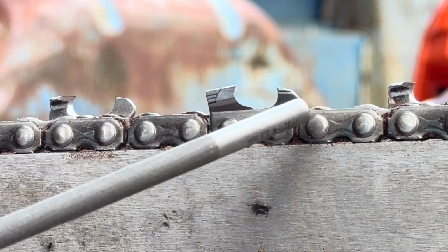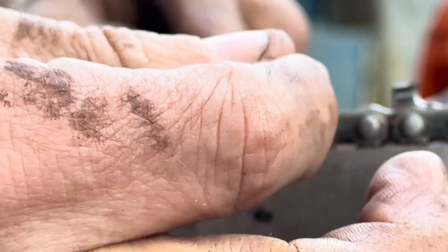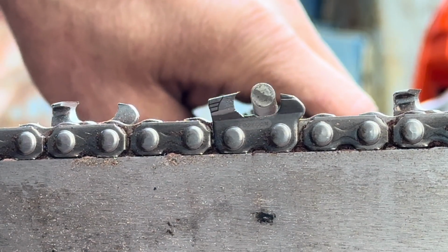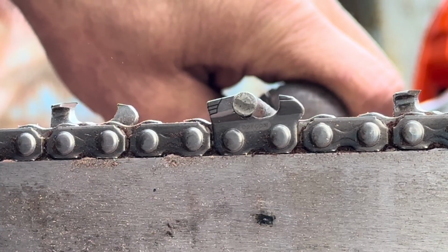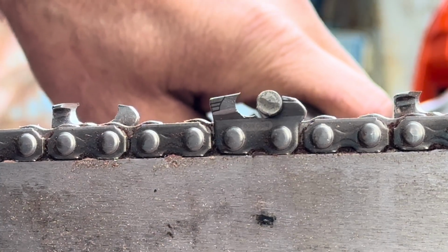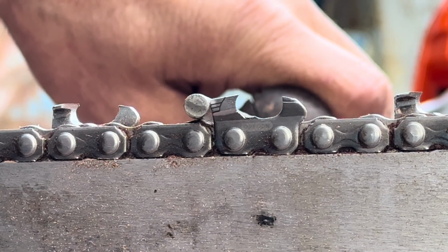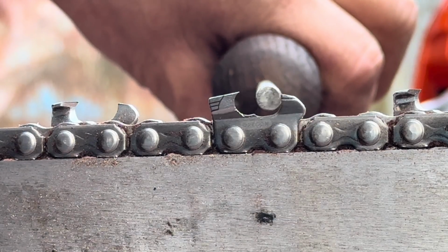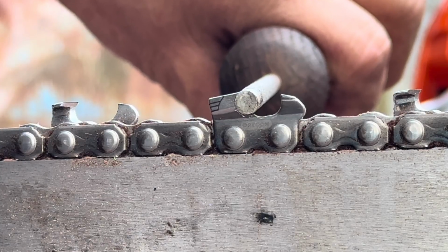Watch this bottom material here. Watch what I'm going to do now. See the C there? Watch what happens. There we go. Now remember, you can almost see the hump where I began. See that? Watch. Whoop, whoop, whoop. Now that right there is because the tooth gets smaller as we go back. This is a 7/32 file. Look. That's a good shot of it right there.